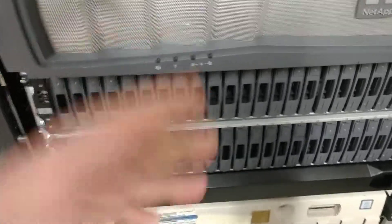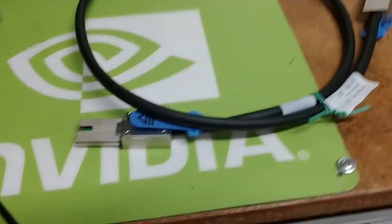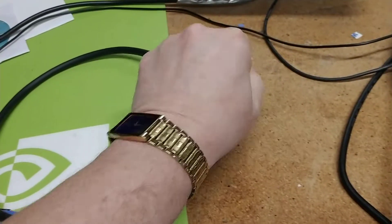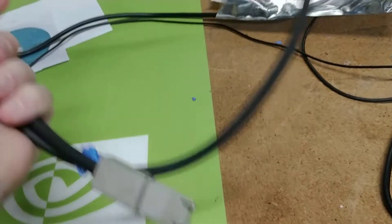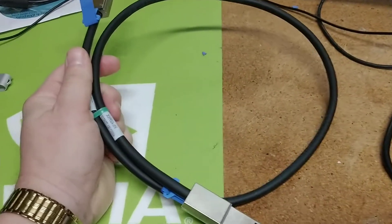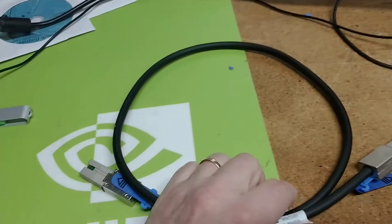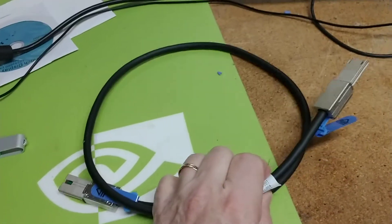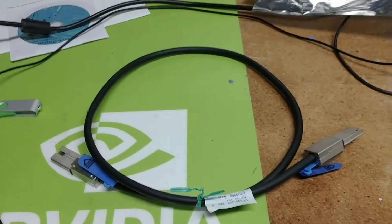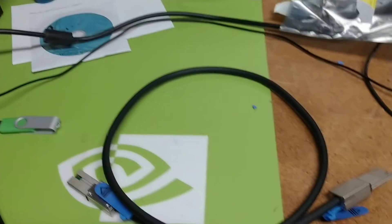Let me show you one. The SAS Mini on one end and the standard SAS on the other are actually just two different heads but using the same protocol known as SAS communication — that is a drive communication protocol. You can also go SAS to SAS if you have a RAID controller that can handle that capacity, or an HBA-based controller card.